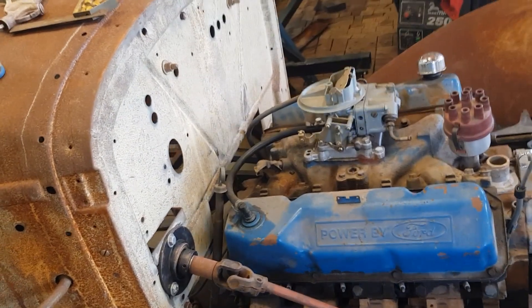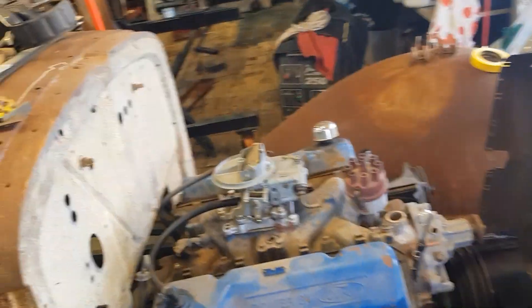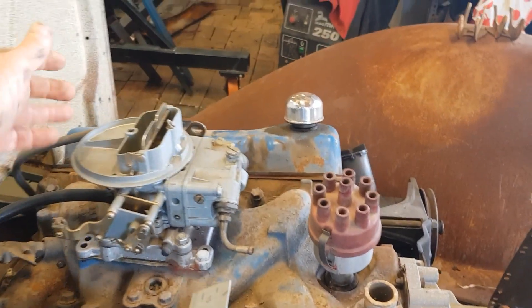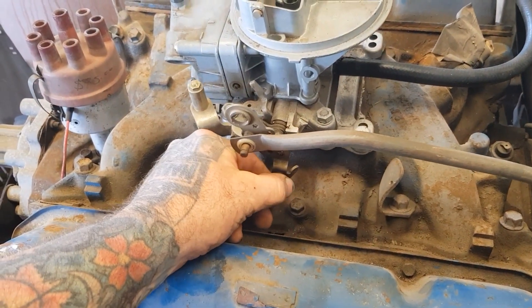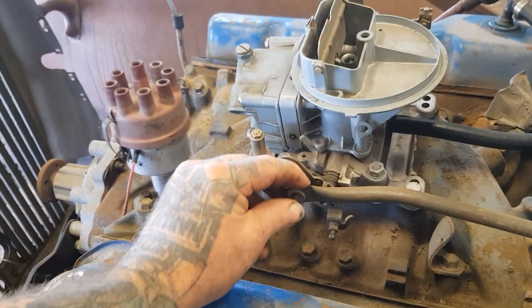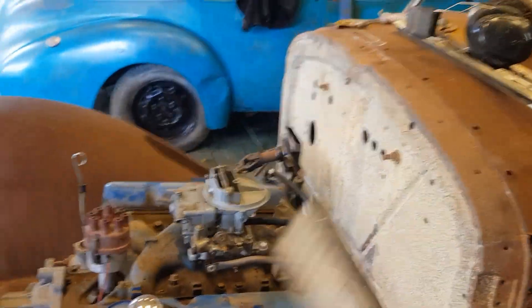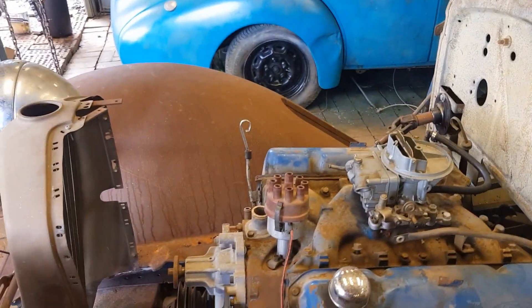What do we have to do to get this motor running? Basically we're going to give it a clean. This is meant to be a very good runner — it cranks over beautifully. We're going to pull this carby off and have a look, because I don't think I could get the throttle working — it was jamming up or something. I think it's fouling on that base plate. We may get rid of the two-barrel and stick a four-barrel Holley on it, or figure out what to do.